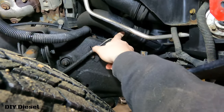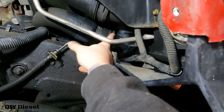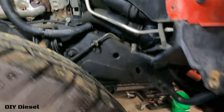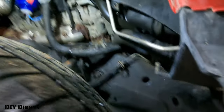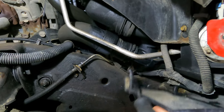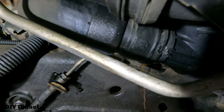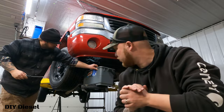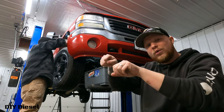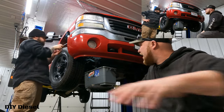Right here is where we're going to start draining the fluid. There was a little clip in here that we took apart — it's just a simple clip, pull it apart and it comes right off. All we're doing is taking a flat blade screwdriver and wiggling it out — as you can see it's already starting to drip and slowly drain. You don't want to pull it all the way off at once because it will just flow out everywhere. Just wiggle it off slowly so you can control it with your bucket.